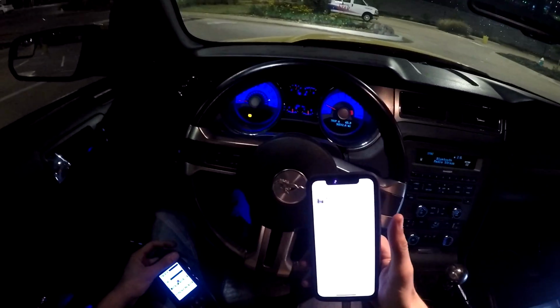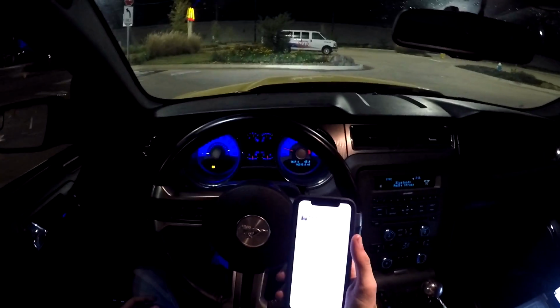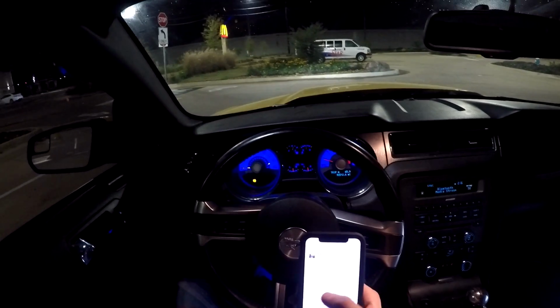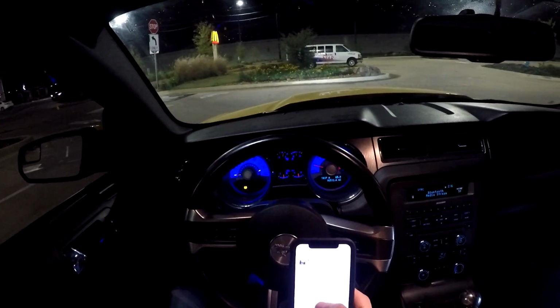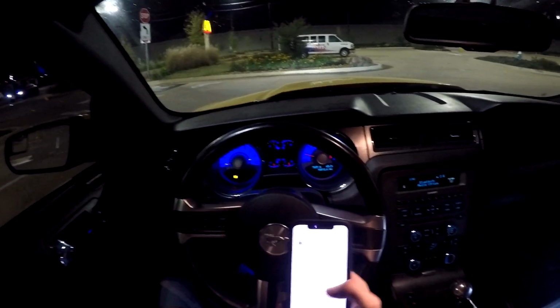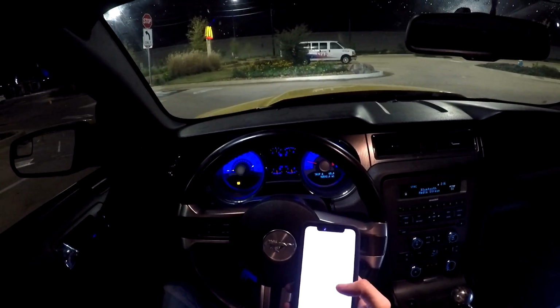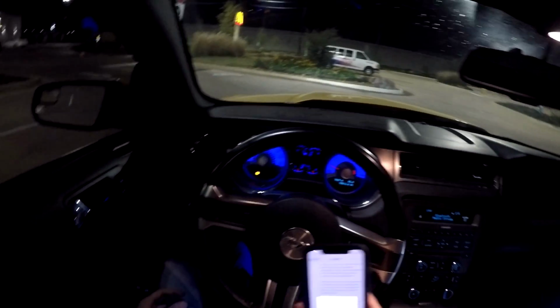I'm currently doing this data log that Lund wants me to do. They said with a new motor, you'll want to break it in rather soon. To do so, we need to use boost to set the rings. Before a pull, I'd like to see this log. I gotta let it idle for 5 minutes and then do a second gear, not a pull, but I gotta get up to 5K in second gear.